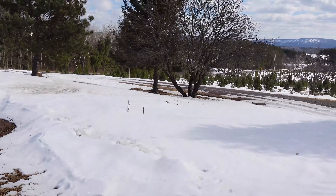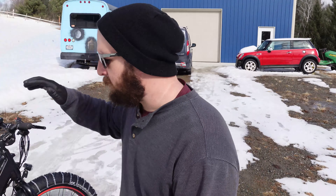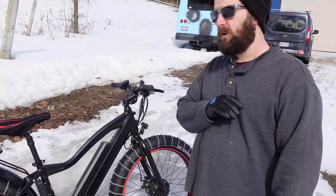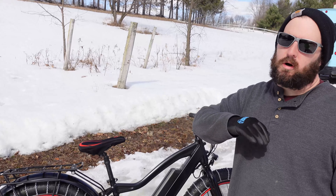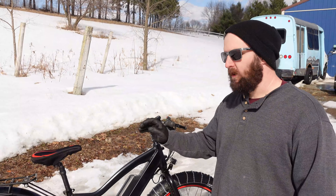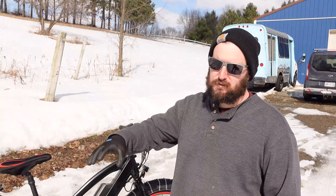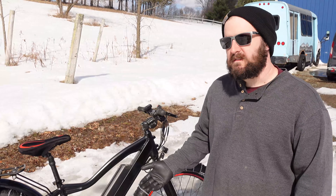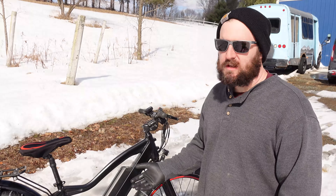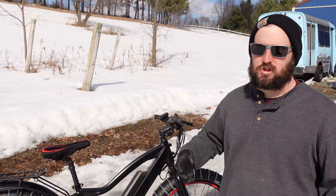What JT found with riding these around — they have some land in Wisconsin and have been riding on gravel roads around a Christmas tree plantation — they work really well when the ground has been plowed and just has that nice coating of thicker ice or a thicker base. It's way better than a rubber tire; it really grabs into it. When it's nice fresh fallen snow and really soft, they still skate around quite a bit and the chains don't offer much. They're really the same as on a car — chains are meant for icy conditions, not fresh loose snow.